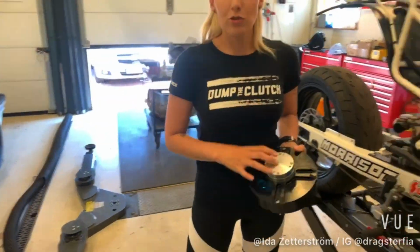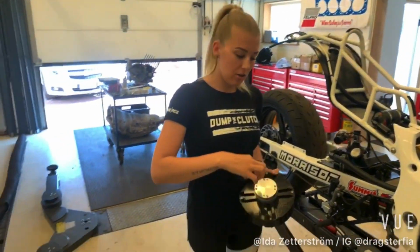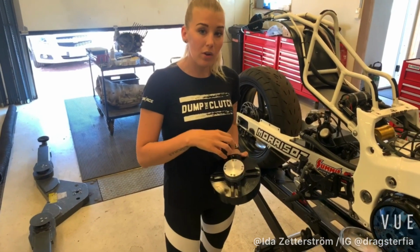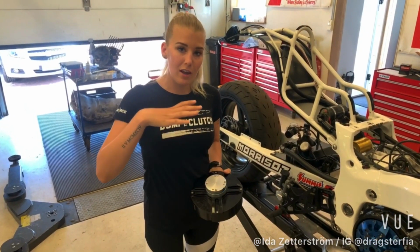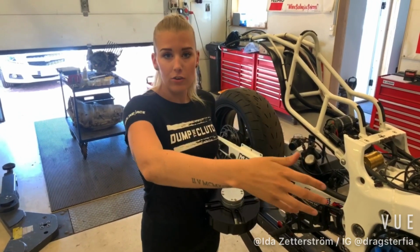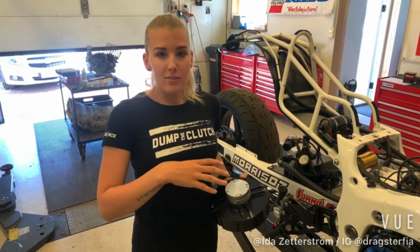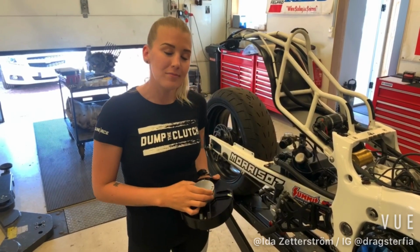So here's also something new for us this year. This is like an add-on for the clutch. This runs with air, so we can run air through this and add on to the clutch to make sure it's locked up. We use it later on the run, like further down track, to make sure it gets real tight, and hopefully this will improve and prevent slip further out.